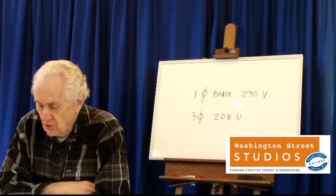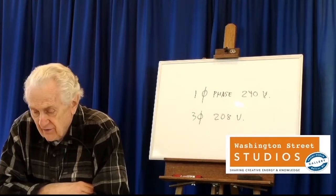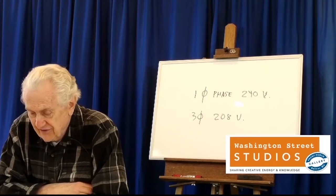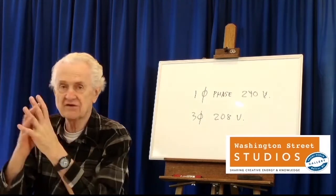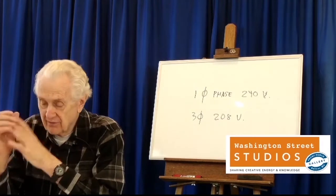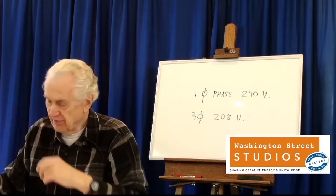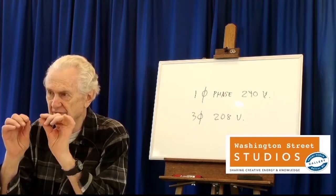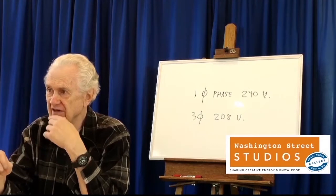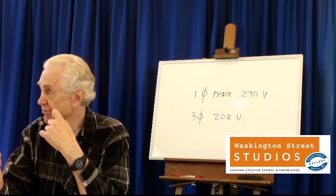Some general things, like, do all the elements work? There are a couple of easy ways to check. If you can trust the person that you're buying it from and they say, yes, they all work, great. But one of the easy things I've done before is take a little piece of tissue paper, toilet paper, just a tiny little pinch, and tuck it in each element, and then turn it on and see if the paper starts to char or burn or smoke.